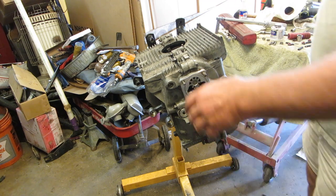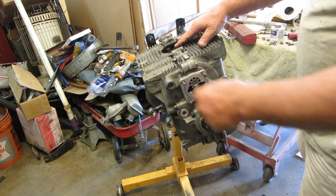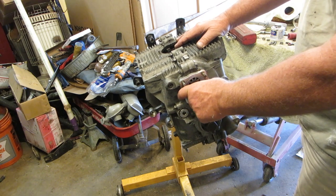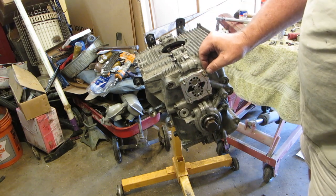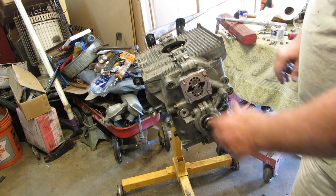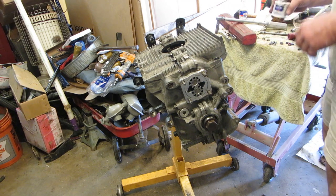So yeah. Okay, why did you put different studs in? Is because my pump housing is thicker. This is a little bit bigger volume pump. And so the casing is a little bit thicker out here. So of course you have to have a little bit longer studs.